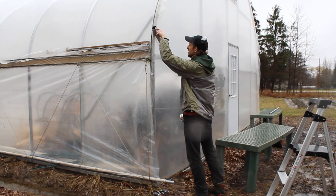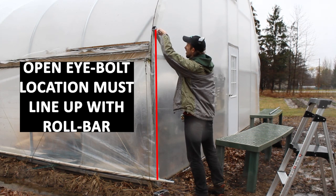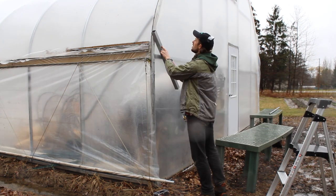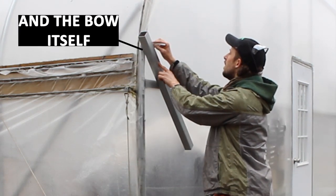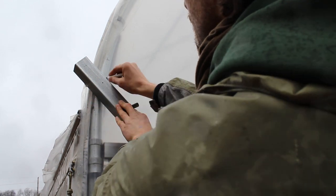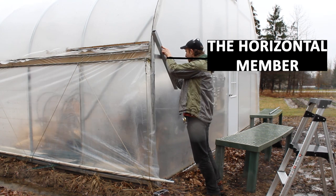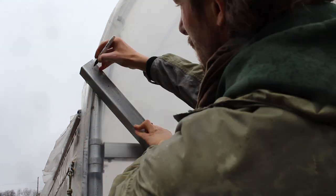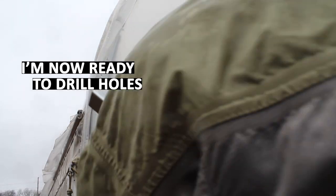Once I've measured 12 inches up from where the plastic attaches to the hip rail, I'm going to rough in this extender pipe again and make some marks. First, I'm taking note of where that open eye hook will be when I hang my guide pipe from it — the topmost hole will be about an inch from its end and needs to be right in line with my roll bar. When you like where your extender pipe is located, mark on both sides of the extender pipe where it crosses over the members you'll be bolting it to. We're also making dots in the middle of the square tubing right where it passes the horizontal member, where it passes the bow, and one inch in from the top end for the open eye hook.